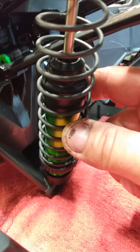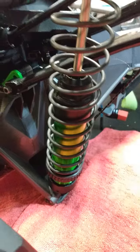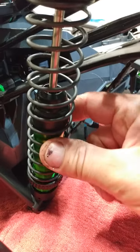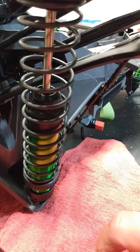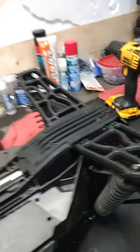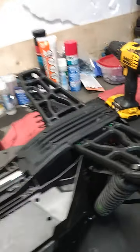The main video is gonna have about 30 upgrades on this thing and a massive jump. I'll give you one more — on the shocks here I have wrapped electrical tape around it so the spring can move a bit, but doesn't let the spring rub the anodized coating off my shocks. It still works, but the springs can't touch the shocks and won't wear the anodized coating off. So the truck's going to look good for a long time.